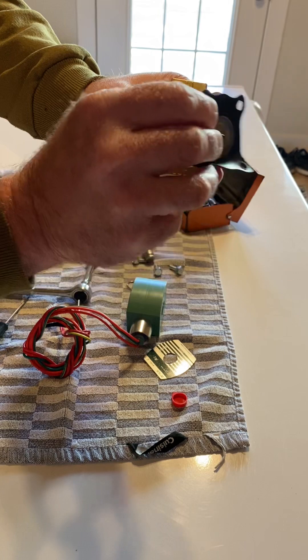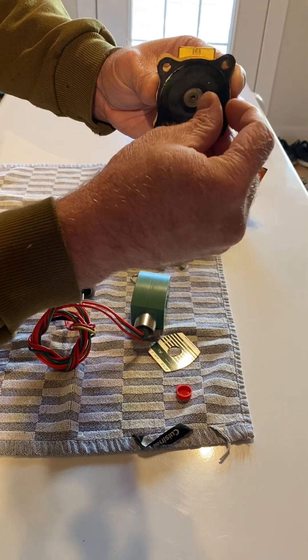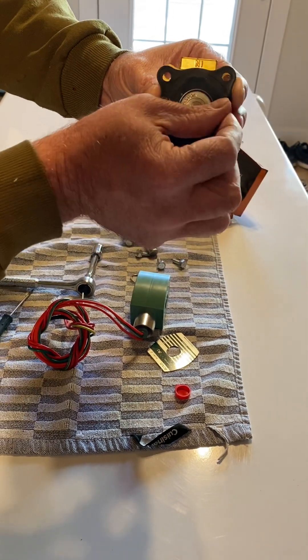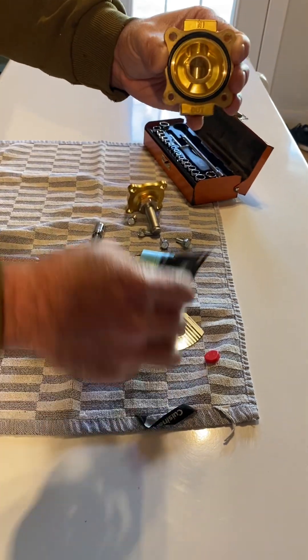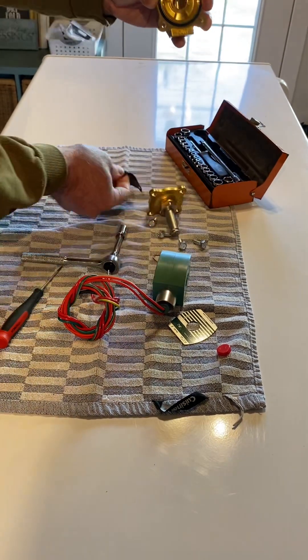This diaphragm comes off, and you can see how when it's pressed down, a seal is made around this brass flange. I've had people install these upside down — of course there's nothing to make a seal that way, it's just metal on metal. The proper way to install it is with this plate sticking out so the solenoid piston comes into contact with that little port.